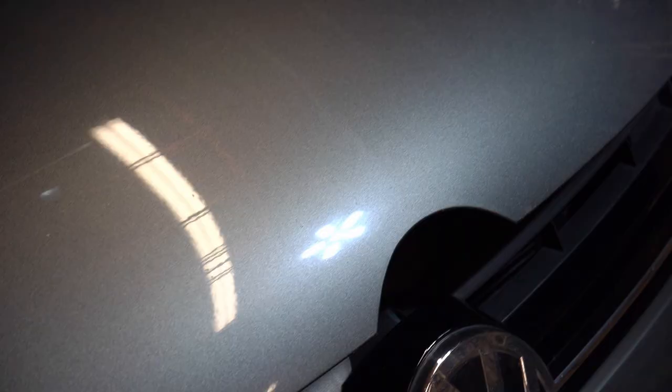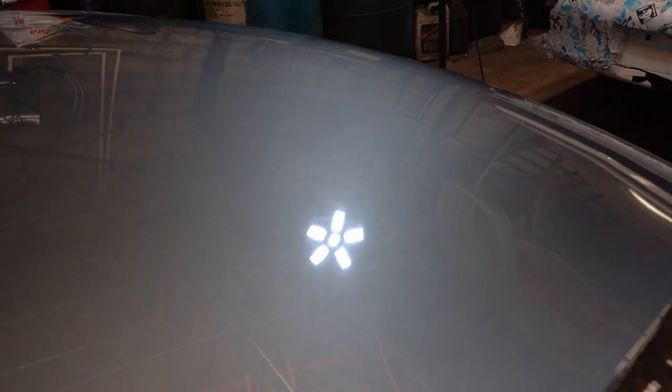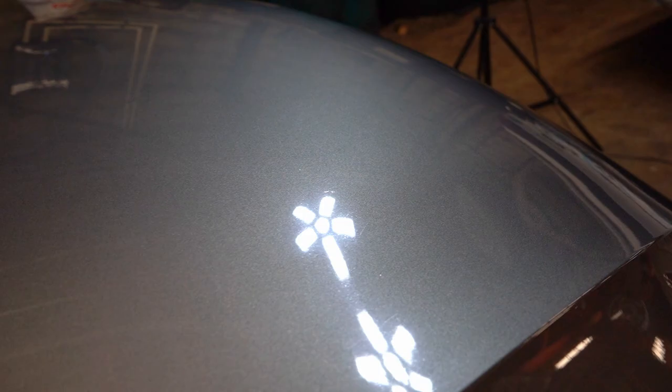Right off the bat from the half and half, you tell that there was a yellowing starting to happen of the clear coat. And although this would seem like a shocker because this is a 2019 Golf R, it was wrapped, like we had found out. Whenever a wrap isn't properly UV protected, over time it can kind of eat away and start to yellow the clear coat. If you don't believe me, go watch the catastrophe Mustang detail I did with vinyl stripes. I'll leave it in the description.